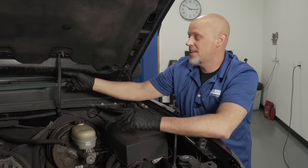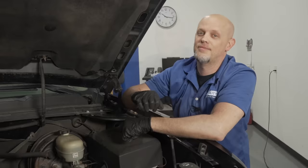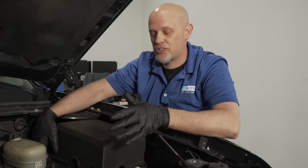There's also a second ground strap — this one is not as crucial. If it breaks, it's a good idea to replace it, but it only affects the ground of the hood. The underhood fuse box is located right here. If you're having problems with any electronics, always check the fuse first. Pull the cover off. Also, mice like to hide in there, so double-check if you're having weird electrical issues.